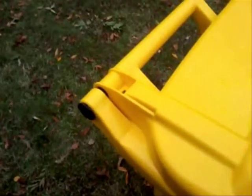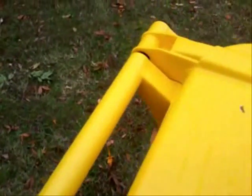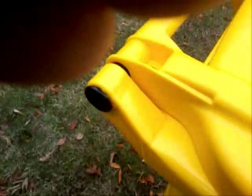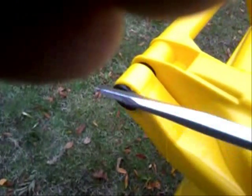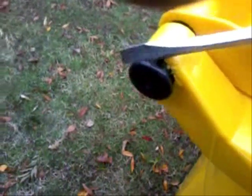Here's where the chip is located — in one side of the hinge or the other, usually on the left hand side looking at it. Take a small flat bladed screwdriver like this, place it right here on the plug and twist it. You'll hear it pop. It clicks in. Sometimes you have to use a little effort to pull it out.